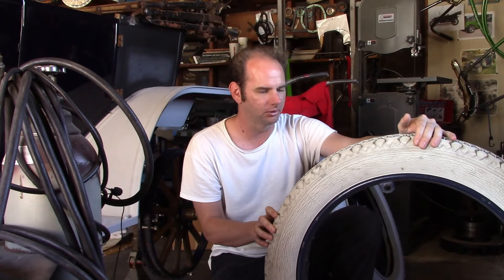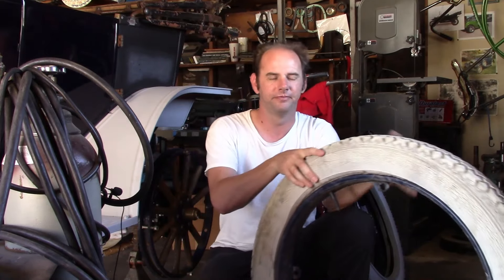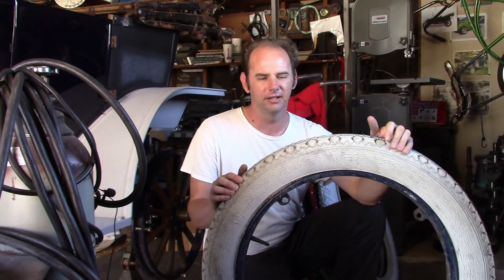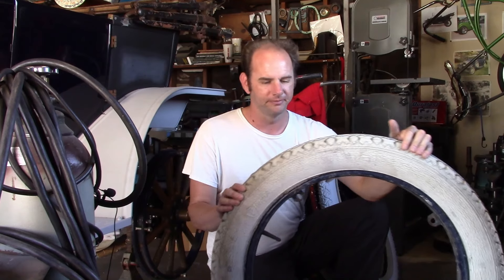And since I'm going to start driving it, I'm finally going to do something about the tires. These are the ones that were on it when I got it and a lot of people have commented they don't look too good — mostly because they're covered with really small cracks all over the place because they're old. The big problem is this tire: on the inside, the bead is starting to detach from the sidewall. When I was driving it, just because of this problem, I had these aired down to about 45 PSI instead of 65 like they should be. Because at full pressure, when these let go, they explode and they sound like a gunshot — which is kind of embarrassing when it happens on the street. And airing them down is not the greatest idea either, because once you get down around 45 or 40, the tires can come off the wheels while you're driving. So this is a serious problem.